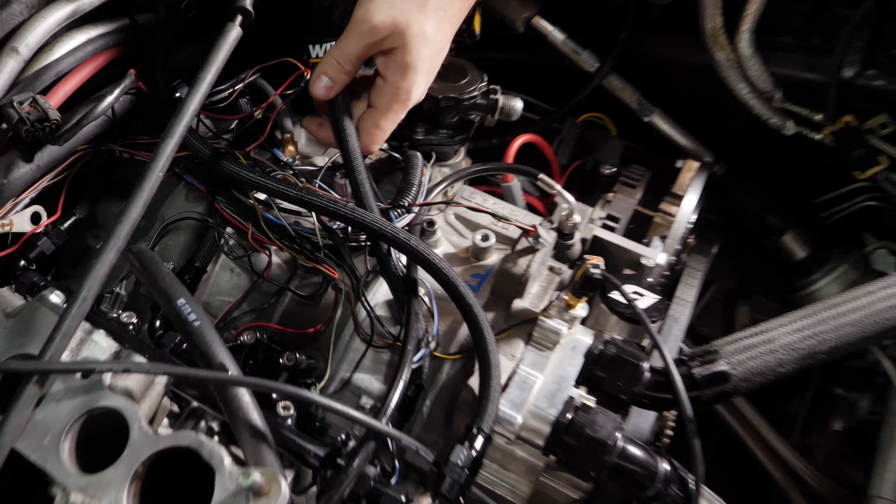The reason we're splitting this video up into two pieces is this is very much RX-7. This is very much rotary, and this is a clean, perfect way of setting up E85. The back half, oh, wait till you see what sort of weirdness a Corvette has. This vehicle has two gas tanks, it has saddlebag tanks, and there's a fuel line from one that pressurizes the other one that spins a pump. There's a lot of weirdness that goes on back there.